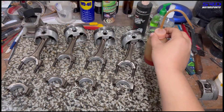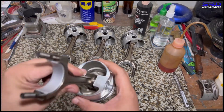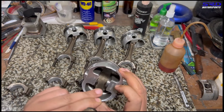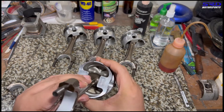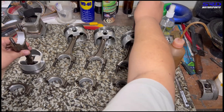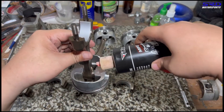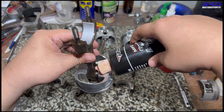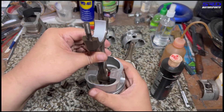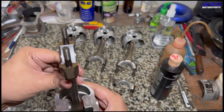The piston rings are installed and oiled with our mix, sitting for 30 minutes so the oil rests properly. You can see the oil thrower ledge and the oil jet — that's where it throws oil to lubricate the pins — but on startup that's all dry. Piston pins can gall, causing wear that robs horsepower, so this prep is a must.